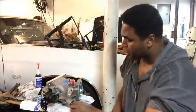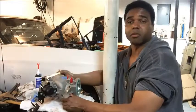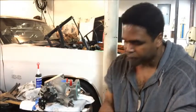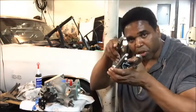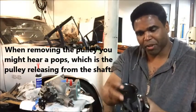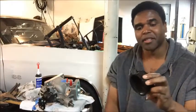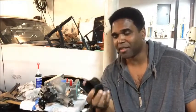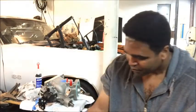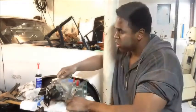I'm going to go with a smaller pulley so I can create a little bit more boost in the car. To remove that pulley, the way I did it, you're going to need a three-jaw puller. You wrap it around, set it up, and pull it right off. Now this three-jaw puller — this pulley — it's safe to say I'm never going to use it again. As you can see, it's pretty much damaged where the jaws grabbed it.